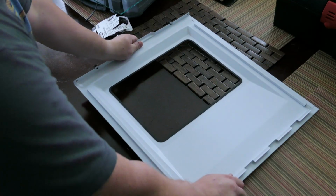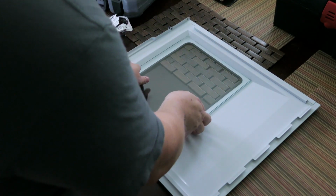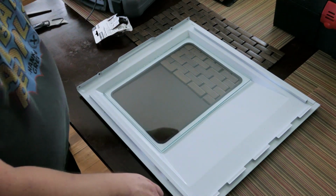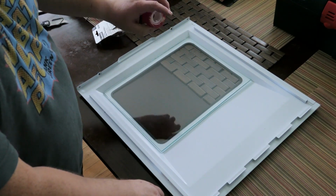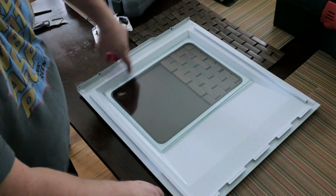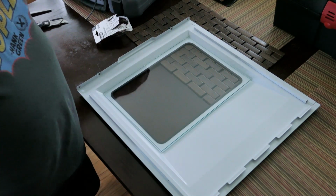So anyway, before you place the glass, you're gonna kind of mock place it, I guess. Figure out where the tape goes. This tape is extremely strong. Maybe for glass, I don't know, but definitely not for acrylic, you do not need to plaster tape the entire length. I would probably do the corners and then bits in the middle, and that's it for acrylic.